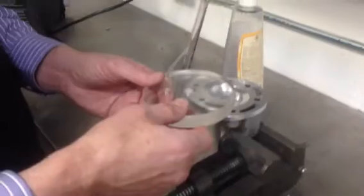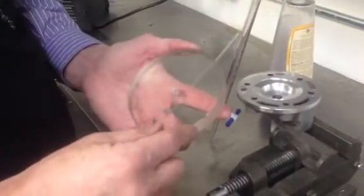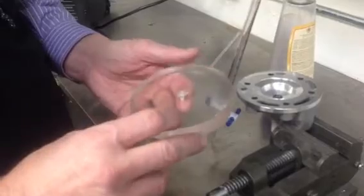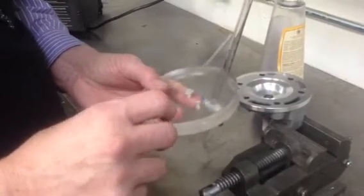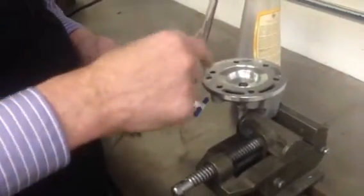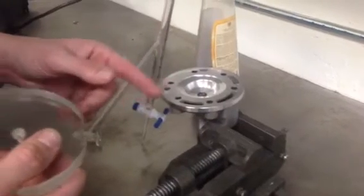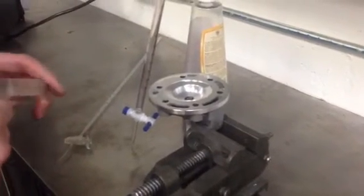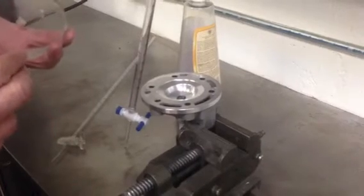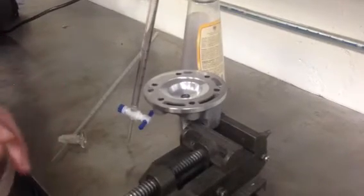You also need a plate to put over the top. This is just a plexiglass piece that we machined on the lathe and drilled a couple of holes in. One side has a countersink so I can drop the fluid in easily, and there's a bleed hole on the other side with a countersink on both sides to let air come out. You can also put your spark plug in the head — I use one with the electrode cut off and filled with putty, so I'm using the same plug every time and getting consistent numbers.